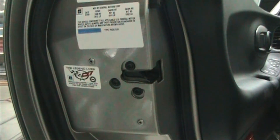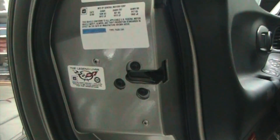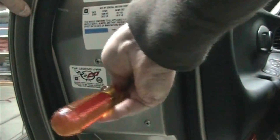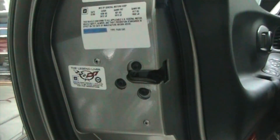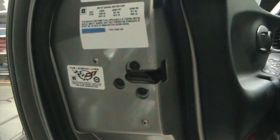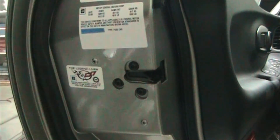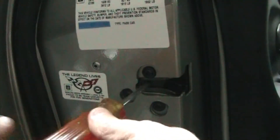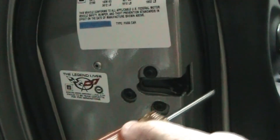You need to prepare the car by opening both doors and then closing the latches. Take a screwdriver and push it into the latch - two clicks and it's latched. Do that on both doors and the car will think the doors are shut. When you're done with this test, make sure you unlatch it before you slam the door. Pull up on the handle and it will unlock - just push it right out.